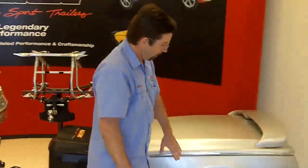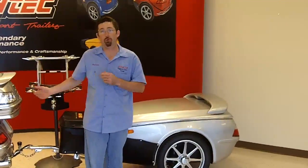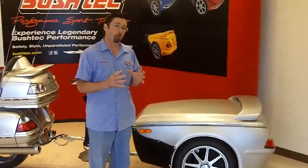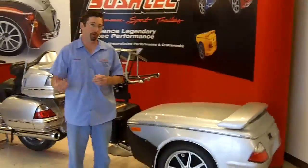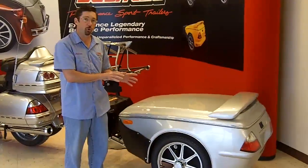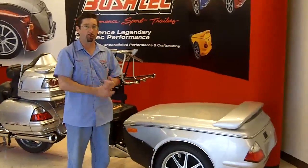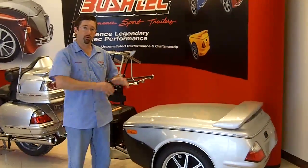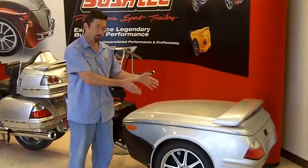The next thing that's unique about our trailers is our wheel and tire combination. We're using a larger diameter 16 inch wheel, so the wheel is going to turn fewer RPMs — basically a one to one ratio with the rear tire on most of your big touring bikes. You've got a wheel and tire assembly in total that weighs 17 pounds. That's 50% less than a 12 inch automotive wheel used by many of our competitors. By reducing the unsprung rotational weight, you're going to have a significant reduction in rotational resistance, related to the inertial effect of starting and stopping that wheel. So it should take less effort on behalf of your motorcycle to accelerate and brake with a trailer equipped with this kind of wheel and tire combination, as opposed to the automotive 12 inch that weighs 34 pounds versus 17 here.